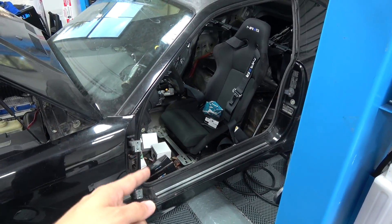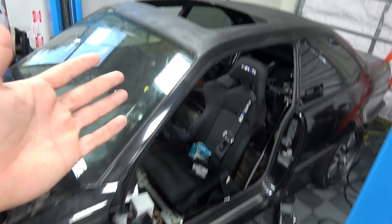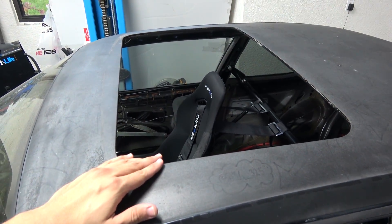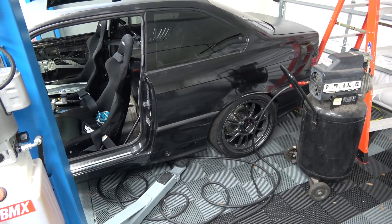I still need to paint the white door I got for the car - the door lock finally came in the mail so I can proceed to install that and finally have a door. I also have to weld the tabs so I can seal it up. As for the rear end, I finally got my bushings and reinforcement plates so I can take that off and reinforce the rear end so it doesn't crack. On BMWs - great handling cars - but when you're going hardcore racing you need to reinforce the rear end, specifically the subframe mounting points, trailing arm mounting points, and rear shock mounting points. If you don't do that they actually do crack and you can damage the car badly, making it very difficult to repair.